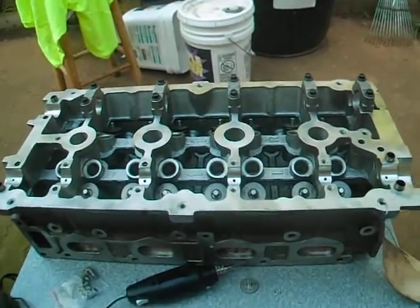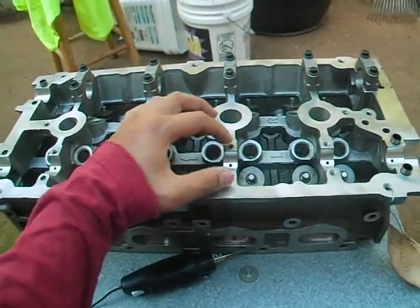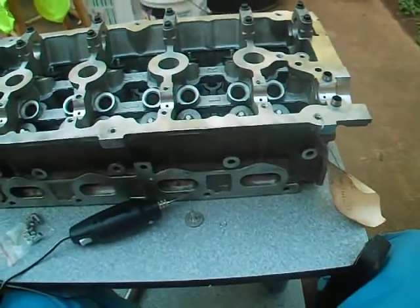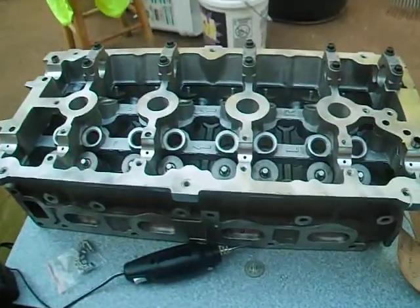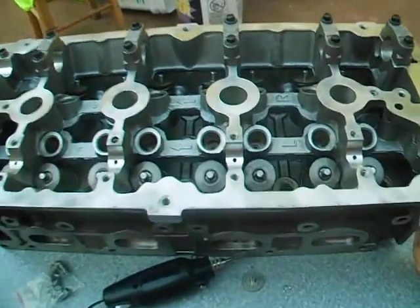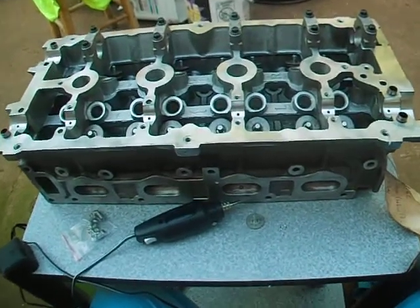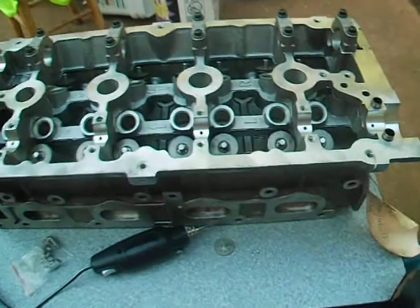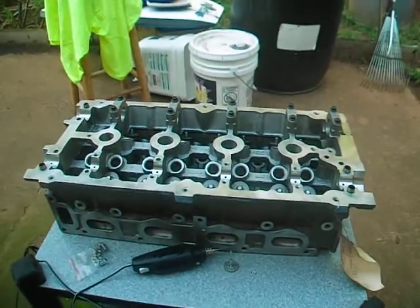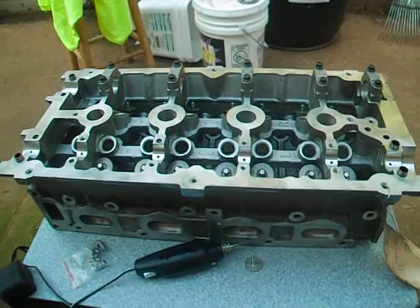So you want to have that part torqued to spec when you do the timing — your camshaft is part of your timing, that's why they need to torque down with spec on each cam cap. That's what it is — I wanted to go through that little issue after you do the helicoil kit repair on the thread holes. You might have that little problem, so just use this information I'm showing you guys on how to fix that problem. Please leave comments, suggestions, and most of all please subscribe to my channel. Thanks a lot, have a good one, and be safe — always wear your safety glasses.